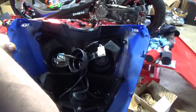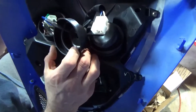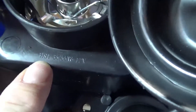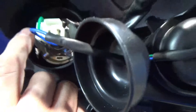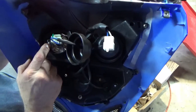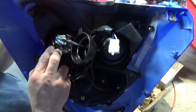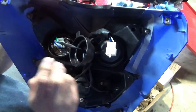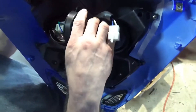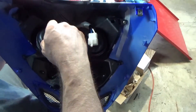On my scooter — sorry it's daytime so it's kind of hard to see — the scooter itself has the bulb name on it. This is an HS1 bulb. If you've ever changed headlights in your car you know what these little tabs are, and it can be a pain to get out, but basically it's plug-and-play. This is just a standard 12-volt LED — it does not have the actual capacitor bank or the stabilizer. My low beam does, and I'm going to show you that.